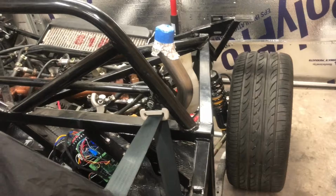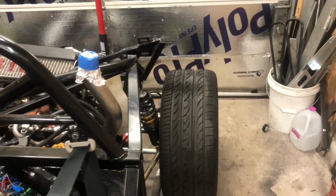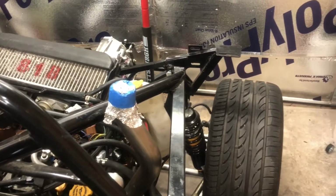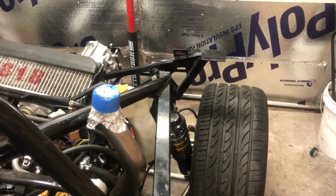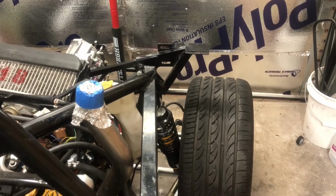So it'll actually do a linear interpolation of what the maximum clamping amp should be, based on the speed. So if you were to have a brake failure and hit the button on the electronic brakes, it would slowly get tighter until you came to a stop. So at least that's the goal. I got to work on it.